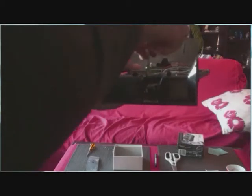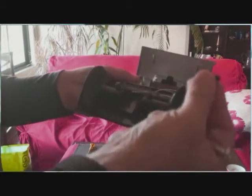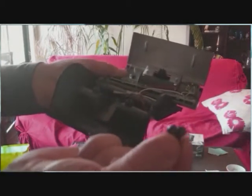When removing this set, you have two little black screws. Now, be very careful. Once these screws are out, all of this, the spring and the sphere, can jump out. So, do it smoothly. Be careful to not lose any piece. Okay. We have the set with the two screws, the sphere and the spring.